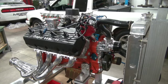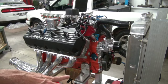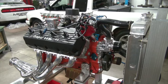You might be able to see the electric heaters down there for the water. Everything ought to be good. I don't know if I pointed out that's a Carter electric fuel pump. I think that's most of it. I think we'll get the test stand rolled outside and put the header mufflers on it. And I bought an air fuel ratio gauge for the exhaust because I wanted to tune the carburetor with that.